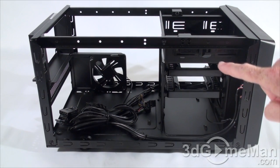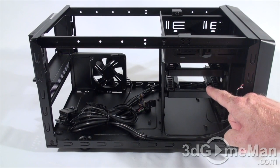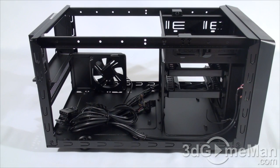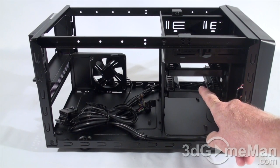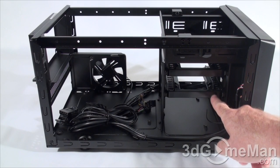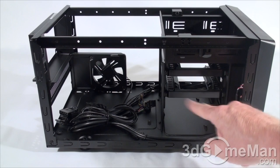As mentioned previously there is one five-and-a-quarter-inch drive bay. You can fit up to three three-and-a-half-inch hard drives or four two-and-a-half-inch drives. They have adapters which basically convert a three-and-a-half-inch bay to accept two two-and-a-half-inch drives, so you could have up to four two-and-a-half-inch drives and maybe one three-and-a-half-inch drive, or a combination thereof.